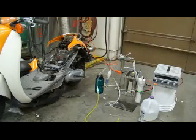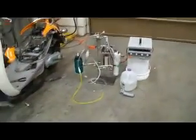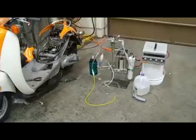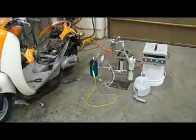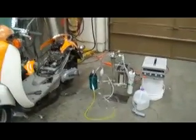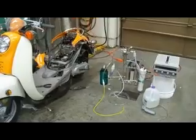Like I said in the last video, I believe that the spark plug may have been becoming fouled from running the hydroxy gas through the engine, and I believe the main reason for that is water coming through and getting in there. It seems like the first time I did this setup it ran really well, and then ever since it's been progressively getting worse. So I took out the spark plug and it looked like it may have been becoming fouled, so I took a piece of sandpaper and rubbed off the electrodes. Here, I'll show you what I got.